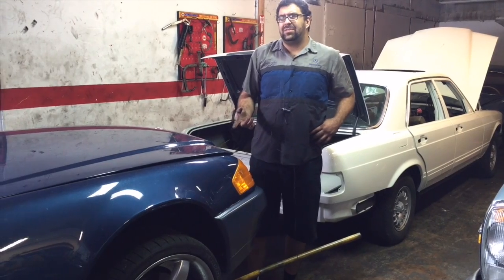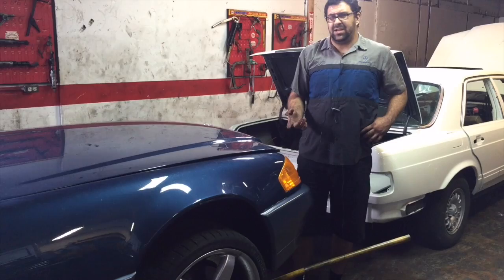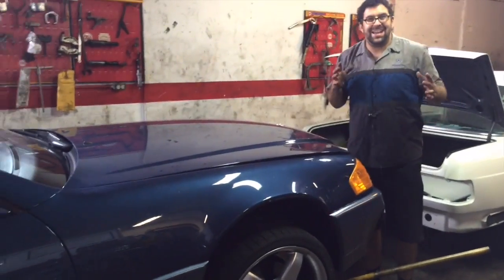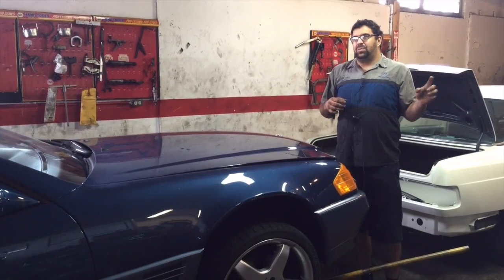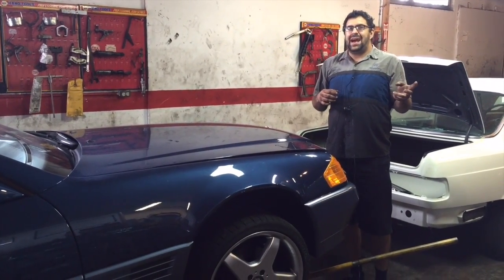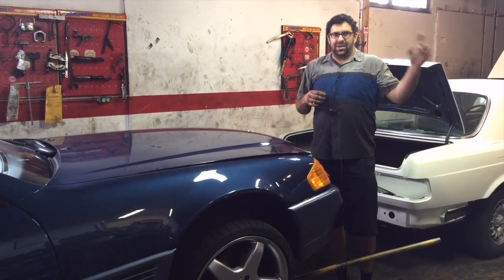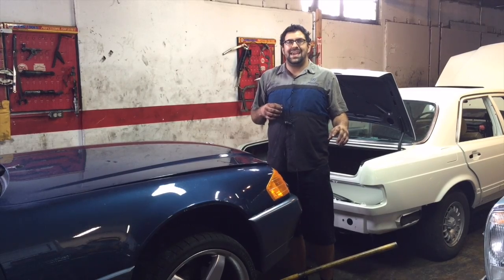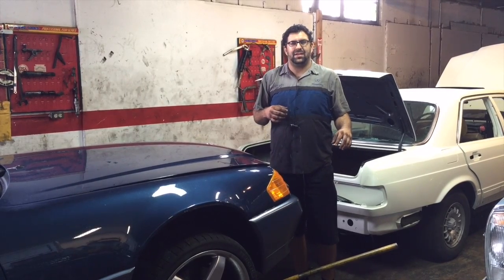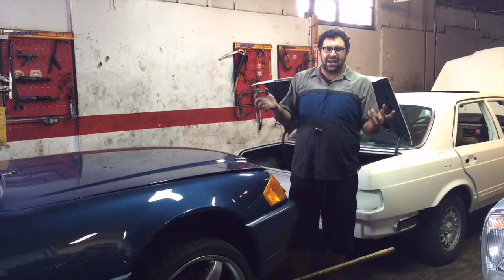The car with us here is a 1990 300SL. It's in beautiful condition. It's got 68,000 miles on it and it's got a minor hiccup when it starts warm. During its warm start, what happens is that the accelerator when depressed once and only once causes a hiccup, a pop, and the car struggles for power for about 10 seconds, then it's fine.